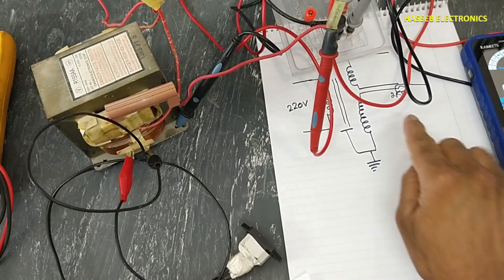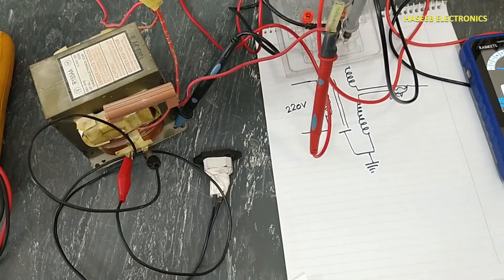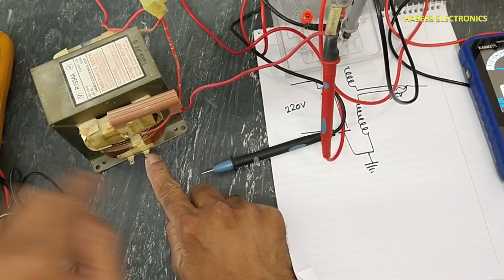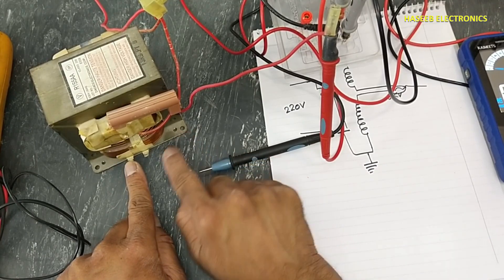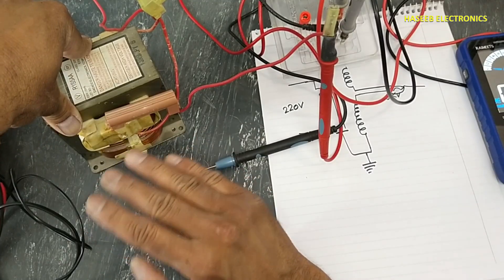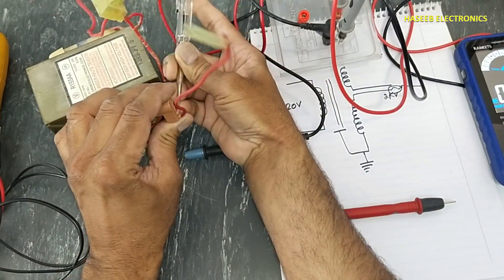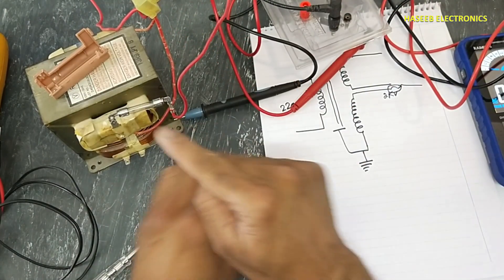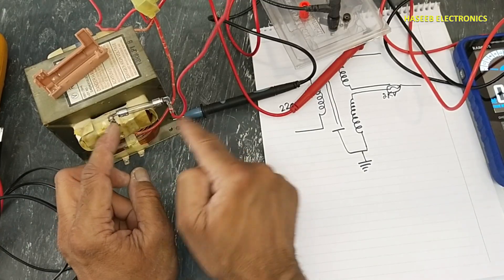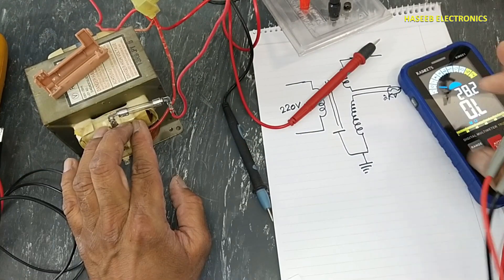If the transformer is giving voltage between 1,800 to 2,800 volts, the transformer is good. If any transformer gives continuity between primary and the chassis, that transformer is bad. If we have visible discolored winding or sparking signs, the transformer is bad. If the high voltage winding is not giving continuity with the chassis, the transformer may be bad — the fuse might be open circuit. Open the fuse jacket, test the fuse. If you don't have continuity, replace the fuse. If the fuse is good but there is no resistance from that point to the transformer body, the high voltage section is damaged.